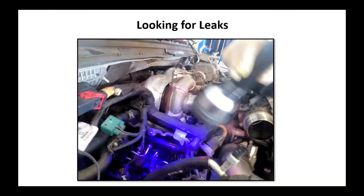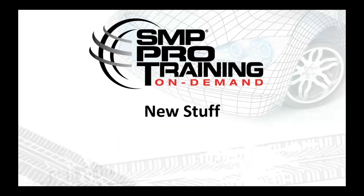Ford has you doing a test like this. Then run the engine here. He's got the valve cover off. He's looking for fuel leaks. This particular one had a cracked fuel injector. The injector body actually cracked and was leaking fuel into the crankcase itself. So dye can help you find stuff.